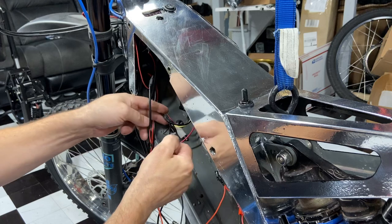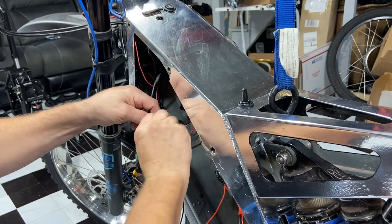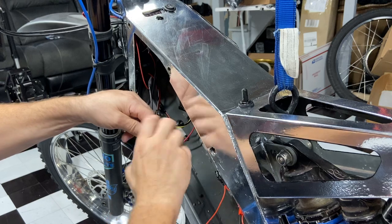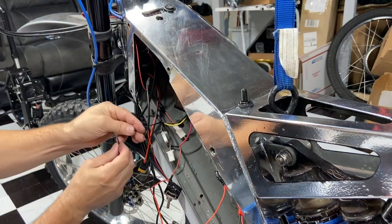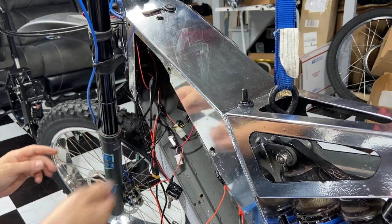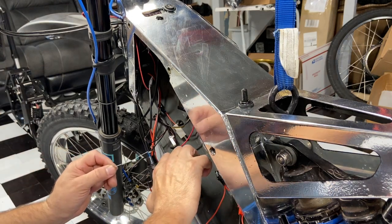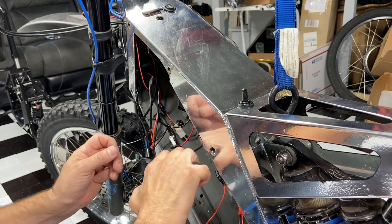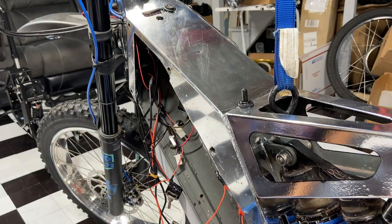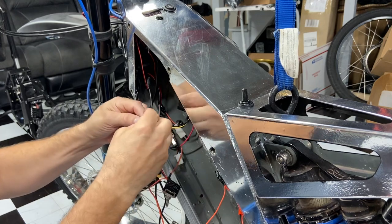Here's the negative that comes off the inverter — all the negative wires — we're going to hook that up to the negative of the voltmeter. This is going to be looped in with the charger port: that black wire is for the charge port. Both the charge port and the battery must be plugged in for this inverter to work — this way you have a loop and it works. I usually use a solder wand; today just one less thing for me to kneel on in my shorts and get burned.